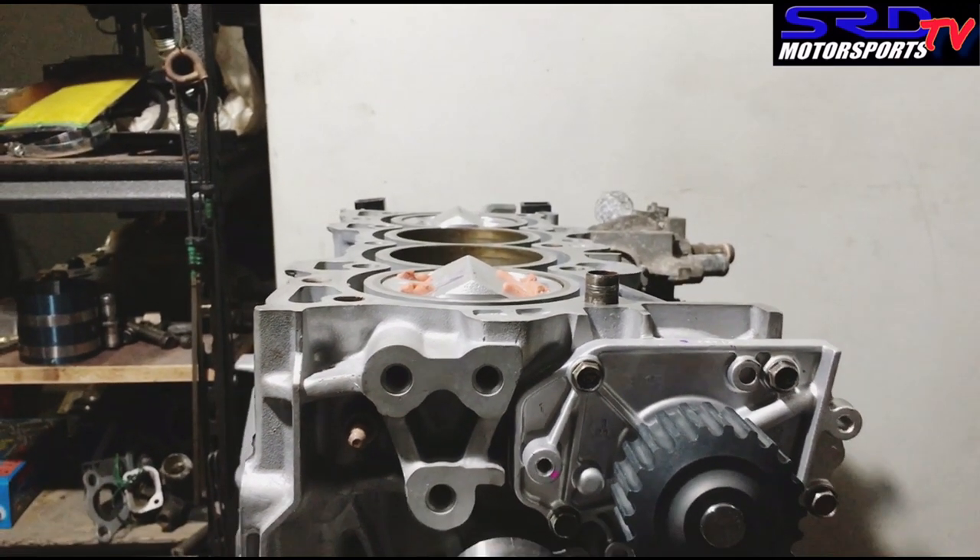We've checked that several times with the caliper and the feeler gauge — through experience, we know it's thick. So basically we have checked zero and advanced two degrees on the intake and it's still safe. We actually tried until advanced three degrees on the intake and that's about the limit. So we will stick to positive two or advanced two degrees as maximum. After doing this, it lets us gain confidence whenever we degree the cams, because we know the certain windows of safety for the engine — from valve-to-valve to piston-to-valve — so it actually gives you more confidence and security, even on the dyno.